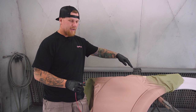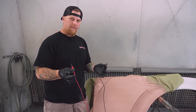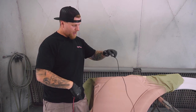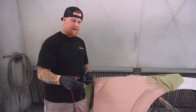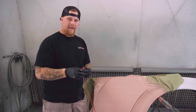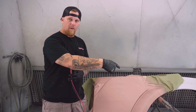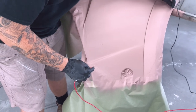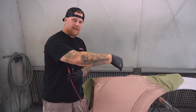Got three coats as even as we could through with backplane, and then we're going to be using a multimeter on the ohms resistance to check how much resistance we have. You need a good path just like you have an electrical wire. Check your meter and make sure that you have connectivity and that everything works and beeps. And then what we're going to do is go down from farthest point to farthest point. I always like to come in where the connection is with the copper wire and go to the farthest point. That way you know you have connectivity.